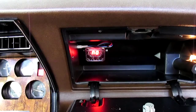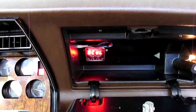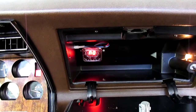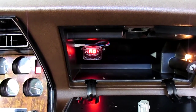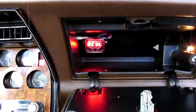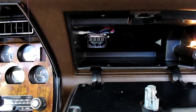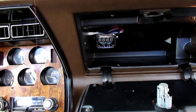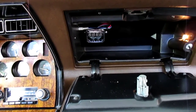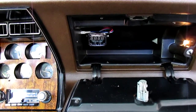And then normally open relay. When it pauses on any of those three settings you can change it - for example, eight cylinder you could change to six cylinder if you're running a six cylinder engine. That's where you change the RPM where you want the switch to activate, and normally open is the contact closure I set for what I'm doing. Anytime the engine is turning over 2000 RPM the fans will turn off, meaning you'd be at highway speed and have enough ram air to cool the engine.